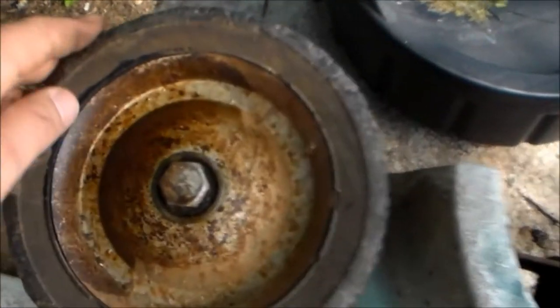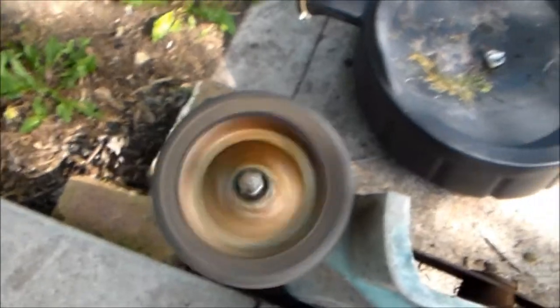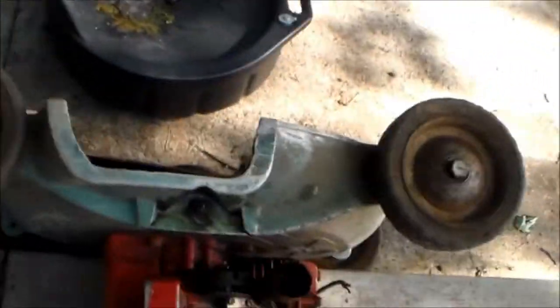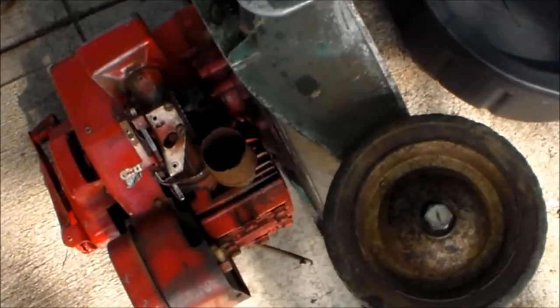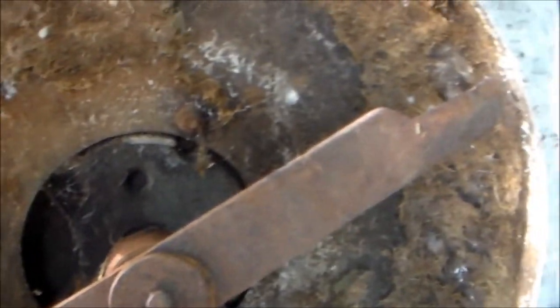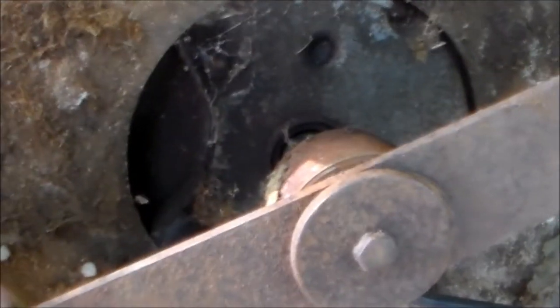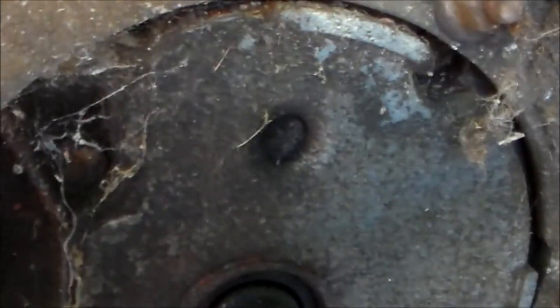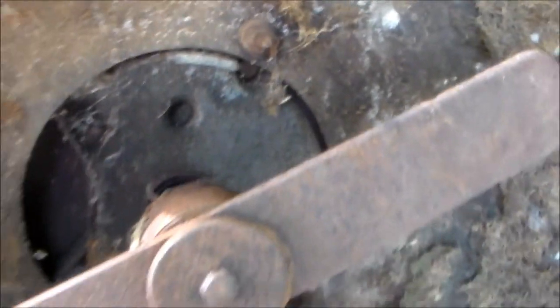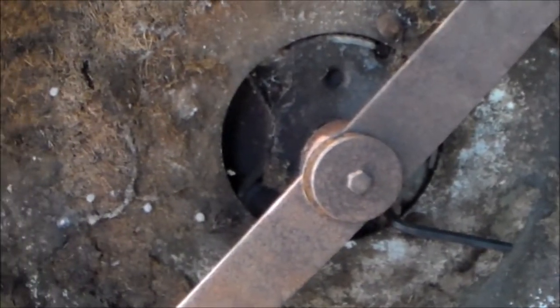Like I said earlier, these wheels are bearing and they're steel. They're all plastic anymore, but look at that thing. That thing will sit and spin for 5 minutes. But I wanted to show you the carburetor. That's awesome how clean it is. So we're going to go ahead and get the oil changed. There's the underneath. I didn't touch anything other than do that. There's the blade, which is not bad for the year. This thing's been sharpened a few times, but it's not bent, and there's no movement in the bearings. It does have spark, and this thing is really, really cool.